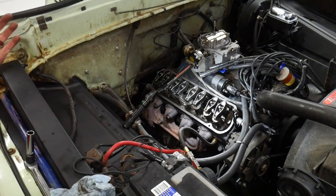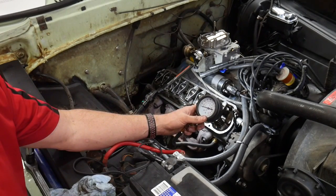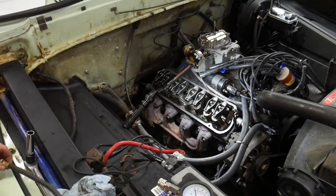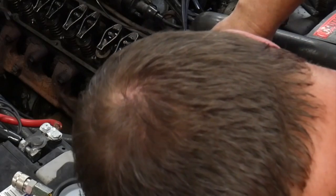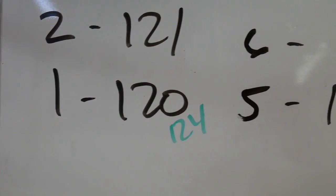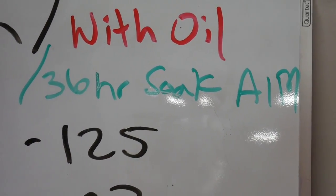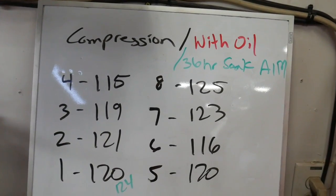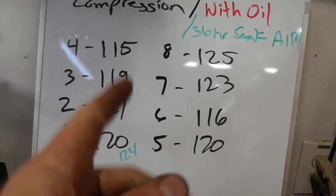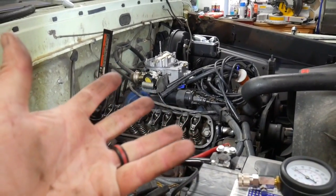124 psi. Okay, so that appears to be working. I'll find the compression stroke and set it back to top dead center. That appeared to work — we went from 120 to 124 compression on that first cylinder. I also updated our list to show a 36-hour soak time with the AIM extreme duty penetrating lubricant, hoping to wake those piston rings up. I'm wondering if this engine sat for a while and that's why it's burning oil, but we did replace the valve stem seals and we'll find out if that improved the oil consumption as well.